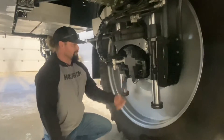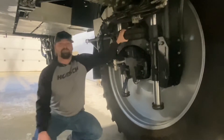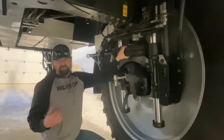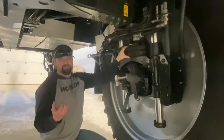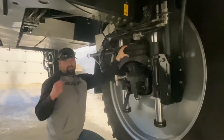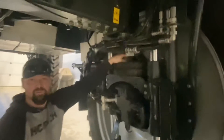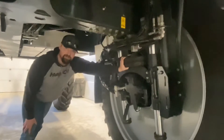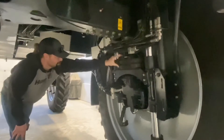Once you have all those steps done, you're going to take the air out of the suspension. It's very critical that the air is removed from the suspension — otherwise you could break the lifting device. The easiest way to let the air out is to just crack this nut on top of each one of the airbags. All four of the airbags have to be done. Get rid of all the air out of the suspension first. Once you do that, the bags will look like this.